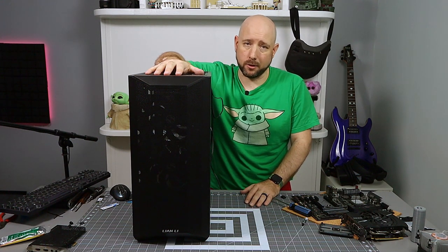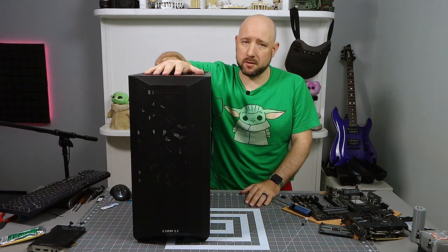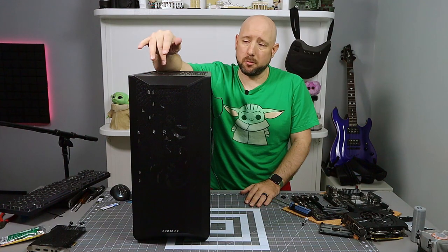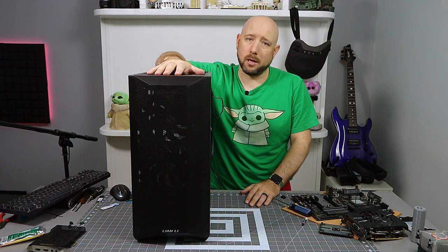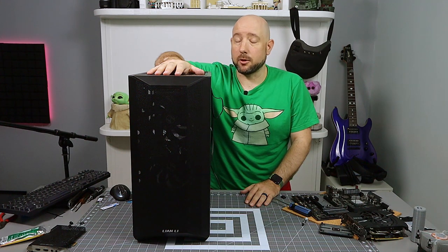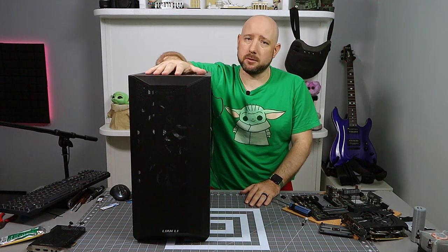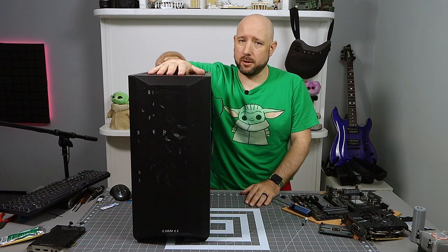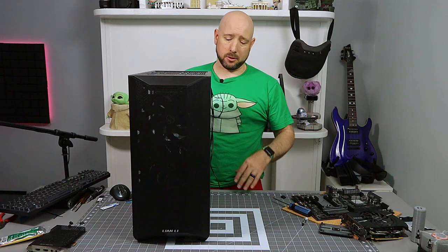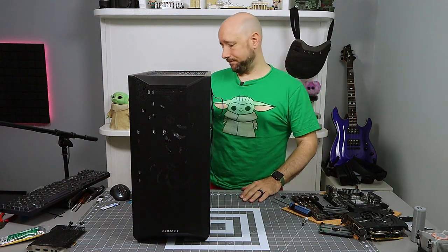And again, that's across video cards. Both my 1070 and the Radeon 6800 both have the same problem. Across CPUs, both the 5800X as well as my old 2700, same problem. After Q flash, it would come up with the BIOS reset message, or if I manually reset the BIOS, it would come up with the BIOS reset message over HDMI, but anything past that generally didn't work. So that's that. So now I'm just replacing and reinstalling everything and getting it back to where it should be.